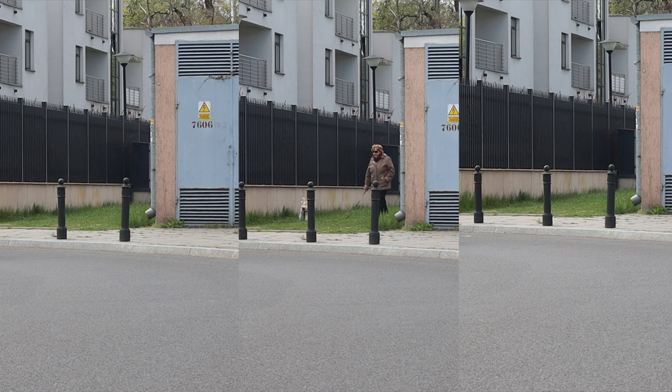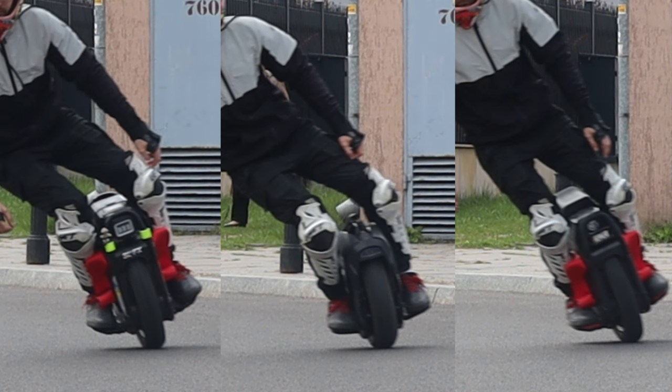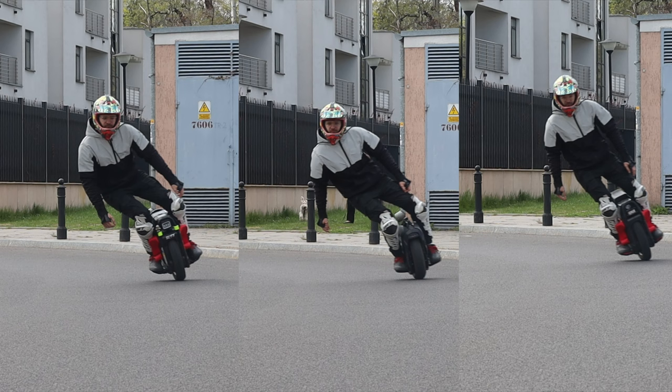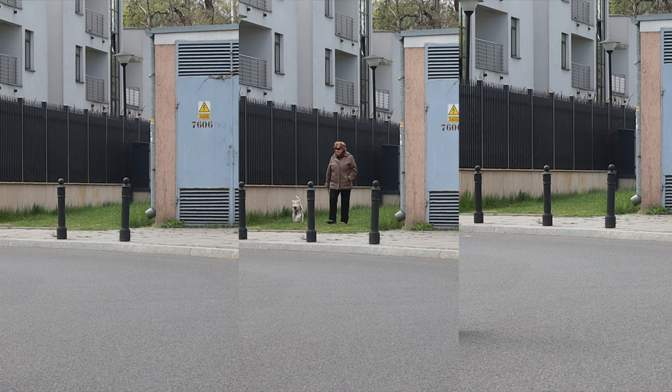When looking at the slow-mo comparison between those three wheels, you can see that the off-road tire makes the EUC lean the most, making it more vulnerable to scratching the pedals. I can turn the sharpest and the most aggressively on the wide, low-profile tire on the Z10, followed by the Michelin City Pro street tire on my Sherman.